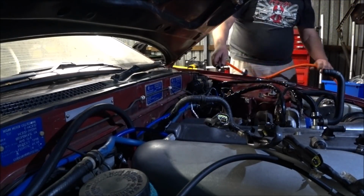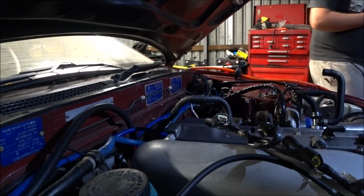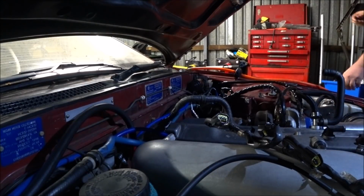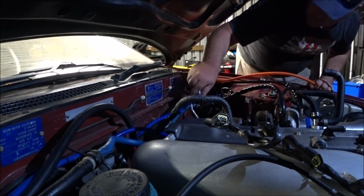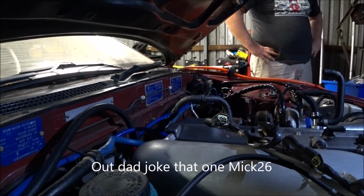So why is it number 6 doesn't leak when I have the same compression? So there is definitely something seriously wrong there. Just try that again and I'll look in the radiator. Nothing there. So we've definitely got a depressed valve. That's depressing.